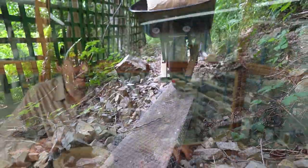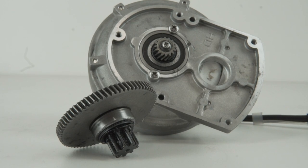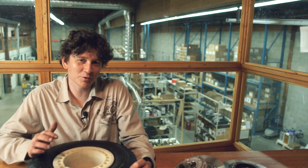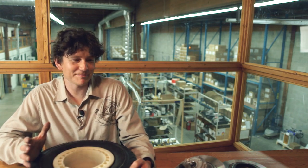This set of gears is entirely steel. Bafang did put a helical angle on the first stage to try to bring the noise down, but it's still quite a bit noisier than we've become used to with bicycle hub motors — so be prepared for this to be a bit of a whining machine while it's running.